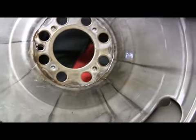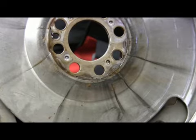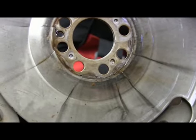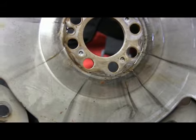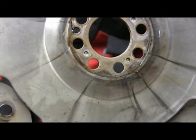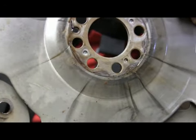So we had a noise that they thought was the motor, and it had a bad oil leak because of all that. It kept losing oil, the light would come on while the guy was driving, and she thought he had ruined the motor. But I think if we put a flywheel on there and replace the rear main seal, we'll probably be okay — because it wouldn't be leaking a quart of oil every mile like it was before.